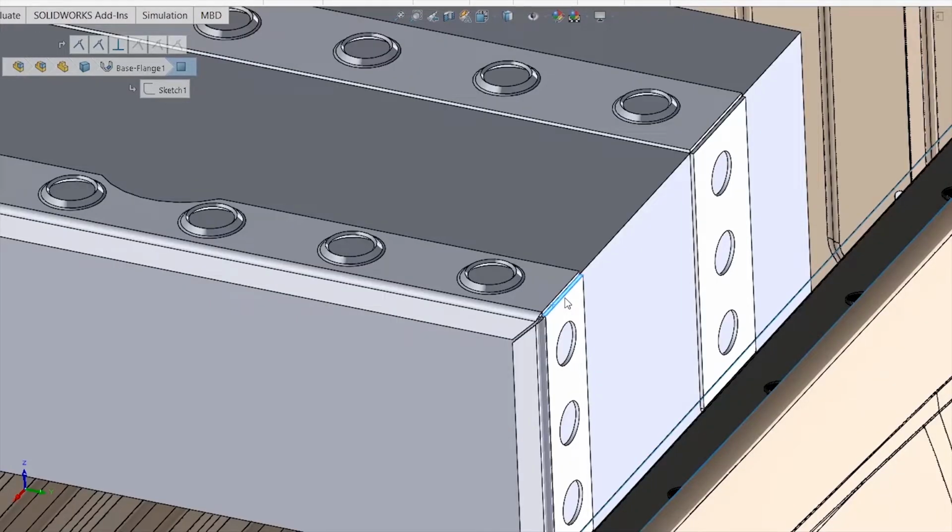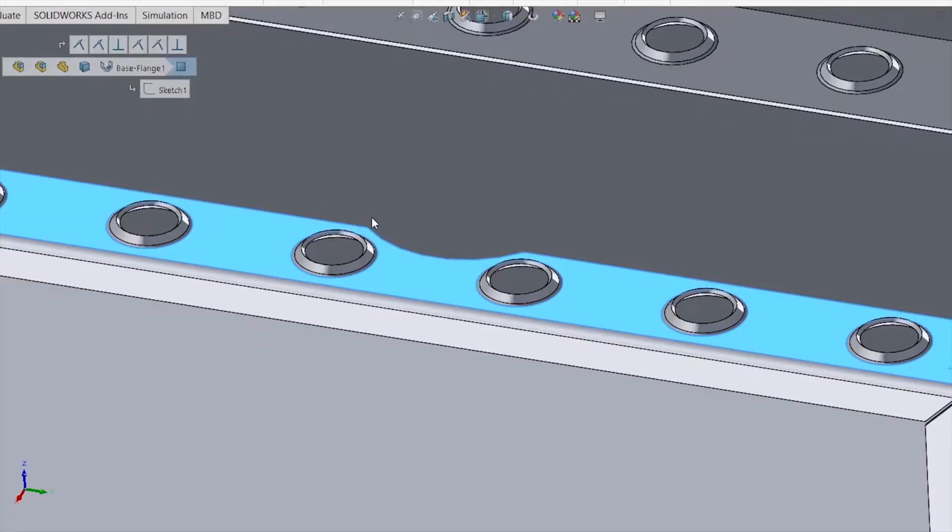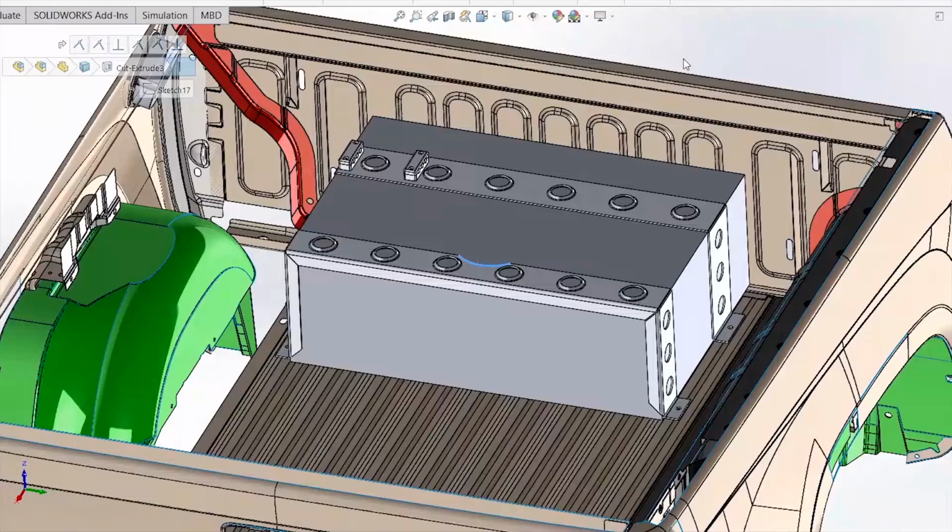Just decided to weld these instead of having everything bent, so it's a little easier to hit the dimensions that I want. I can cut the sides to length and then weld them to the top cross pieces. And this little cutout here is right around where the fuel pump hat will sit. Hopefully it all works.